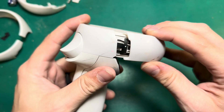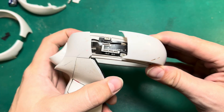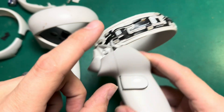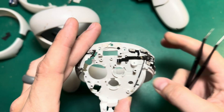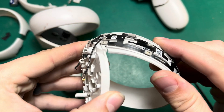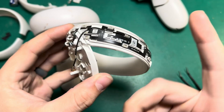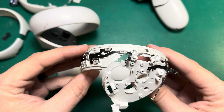Another thing I really like to look for is whether the frame is intact and the ring on the inside is intact, but how are the LED ribbons? If you take your ring off and you see a little bit of wear and tear, or if you see that the ribbon is completely severed, then you're in trouble. Because at this point, even though this inner ring is kind of intact and it's got a crack in it, this ribbon needs to be replaced anyway, so a simple outer ring repair is not going to fix the problem.